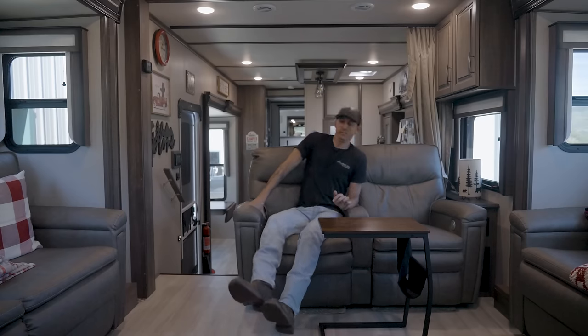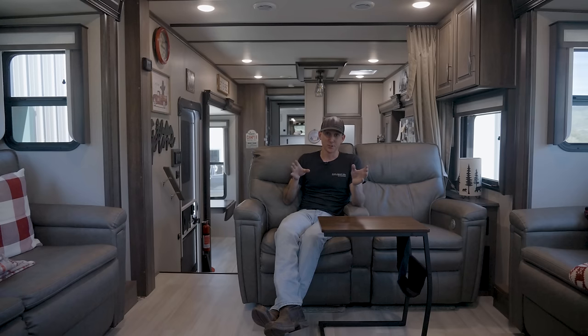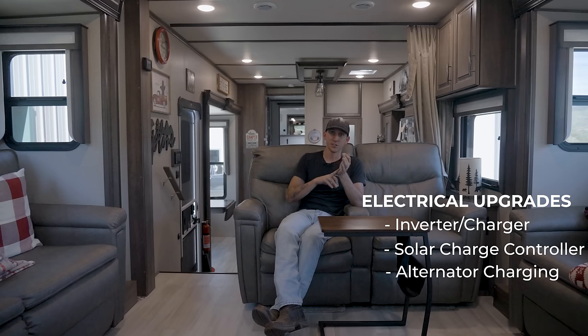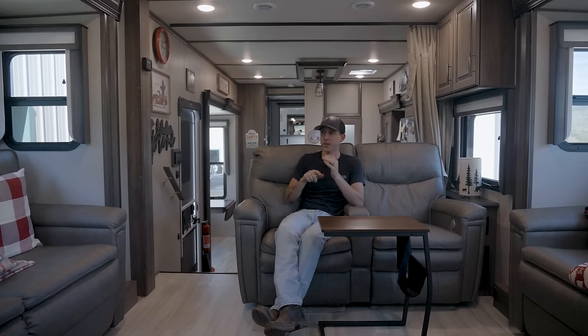Let's talk about the plan and some considerations for the electrical upgrade. In this electrical system we're going to be doing some of the same upgrades we've been doing all year: an inverter charger, a solar charge controller, DC to DC charging for alternator charging, and we're just going to be splicing into the OEM electrical system for both 12-volt and 120-volt sides so that everything works as it does from the factory. The only thing we're not going to be able to power is both air conditioners at the same time when off-grid - they'll work fine when plugged into shore power at a campground, but to run both we would have to double the inverting capacity as well as double the battery bank capacity.